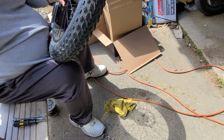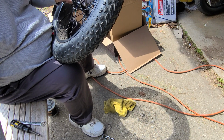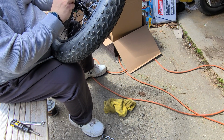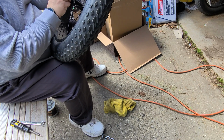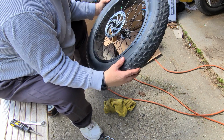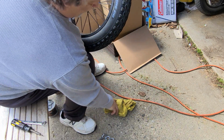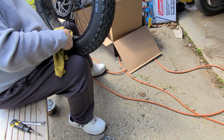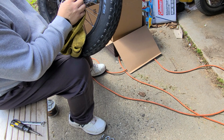And it goes in a little slot there, but it's in that slot. So, put my axle retainer back on, and the 14 millimeter axle nut. Make sure you leave a little room for you to get it back on there right. God, I get grease everywhere somehow. Must have had it on my hand. Take some time if you want to and clean everything up.